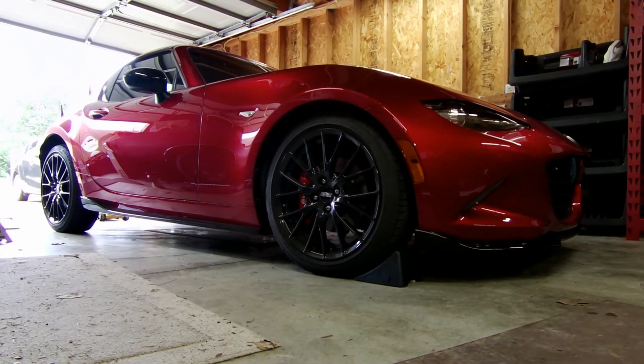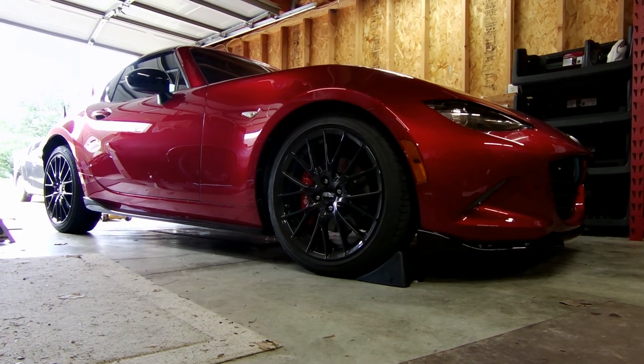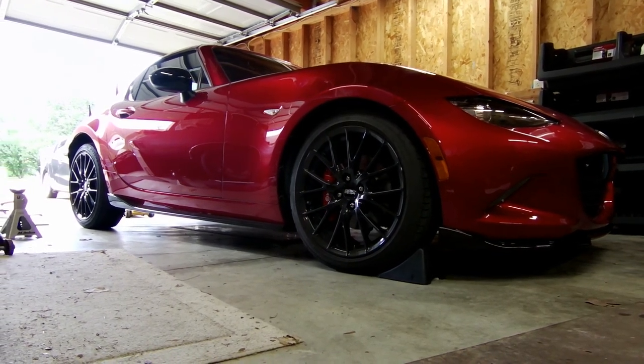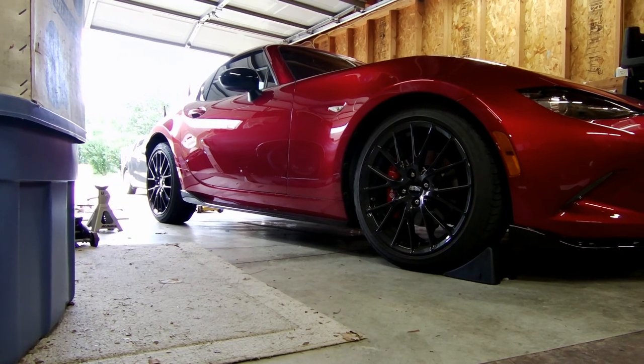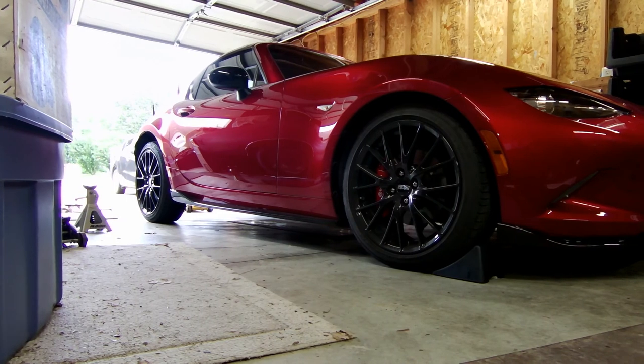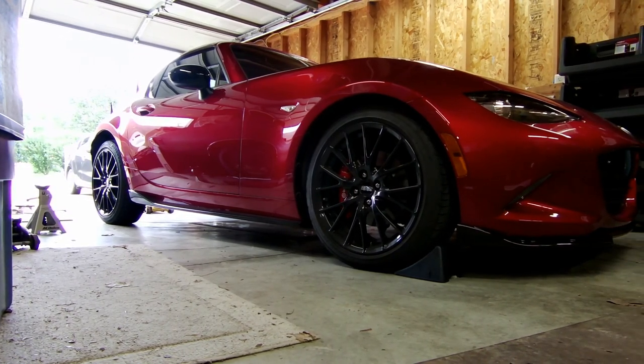The left front was 13 and a quarter inches, the right front is 13 and an eighth. This is just lowering them and then bouncing the front down a little bit. It might settle a little — I'll probably have to adjust them at some point. You have to drive it and then come back and recheck everything. You can see the rear hasn't been touched — they're way up there at like 14 and a half stock. Front is done. Hopefully it was helpful — if so please like, subscribe, comment, and good luck with yours.